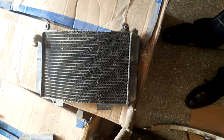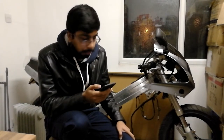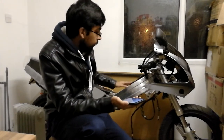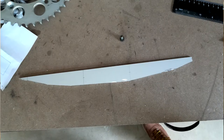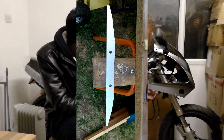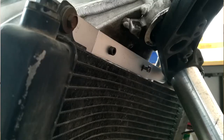I also got a radiator from Pakistan, but that needs extensive repair — there's a leak on the core and the pipes leading into the hoses are very corroded. Around that time summer came, the weather was nice, and I was coming into the garage every day. I fabricated a radiator mount myself out of 2mm aluminium. The stock one is 3mm but 2mm is fine here because this bracket just holds it in place — the weight is supported by other brackets underneath.